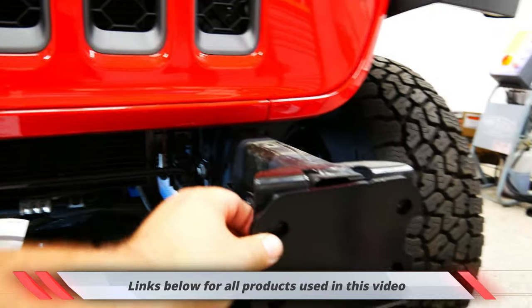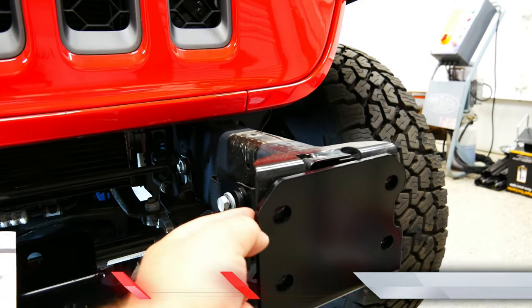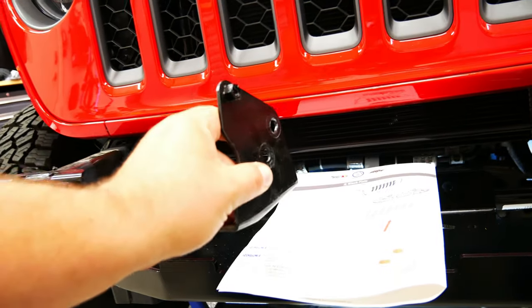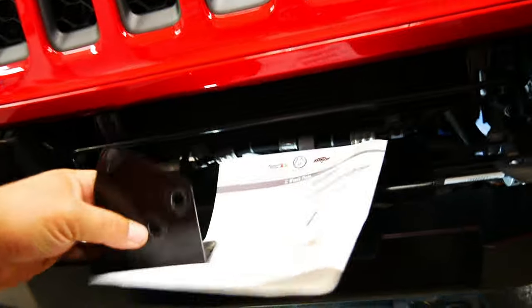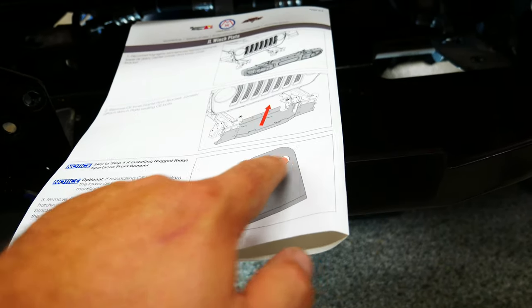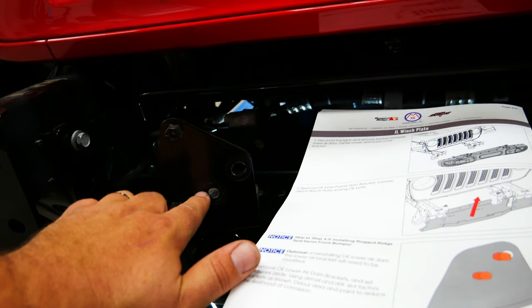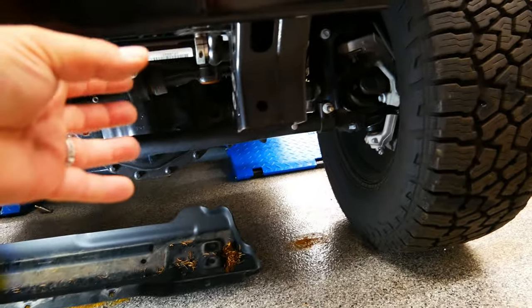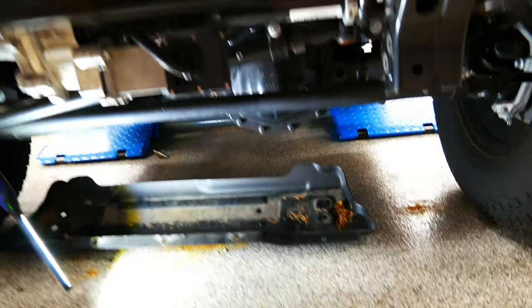Alright guys, we've reached an important part of the installation. Just a reminder, I'm giving away a $100 Amazon gift card in November — just subscribe and comment on a video to enter. So if you're using the Rugged Ridge winch mount plate, you have to do one modification. With the Rugged Ridge plate, the bumper installs about a half inch forward. That means the brackets underneath also need to move half an inch forward so you can still mount the skid plate, which means these holes need to be bored backwards a bit — about half an inch on both sides.